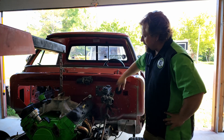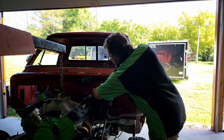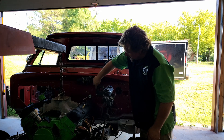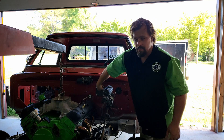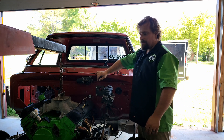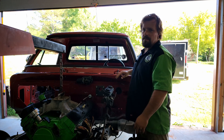We have our adapter plate all bolted in here. The master cylinder is actually going to have to bolt through the bracket that is the pedal assembly. Rather than cut this out and take strength out of that pedal assembly, I'm just going to drill that hole out and put the bolt from the inside there, and then this one will go through the firewall as well. I have to trim out the top here so the master cylinder will fit, and then we're going to leave the master cylinder out of the way for right now because we need to go ahead and get our firewall painted.